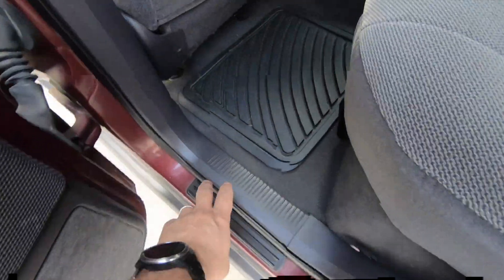The one at the top comes off real easy — you just pull this down towards you a little bit. It helps to have a piece off and it should just come right off. Gotta be careful because there's a plastic piece that holds on to the headliner, so you don't want to pull that off too hard. Just this plastic piece here. That comes off relatively easy — same way, just a couple clips holding it with a couple guide rods.